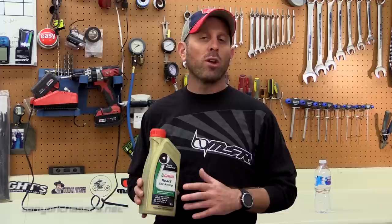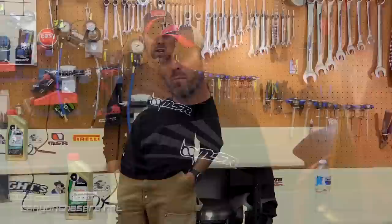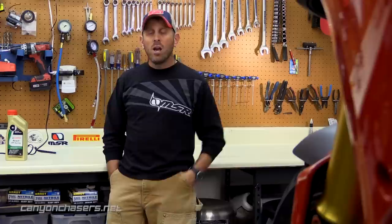We flushed the front and rear brakes on several Multistratas and still had a little left over. Here's the thing: the dry boiling point on the Castrol SRF is lower than the racing fluid by a few degrees at 590, but its wet boiling point is more than 100 degrees better — 520 degrees. We wanted to be sure before recommending anyone spend $70 on brake fluid, and it absolutely works. We put the React SRF into four different Multistratas ranging from a 2012 to a 2016. The brake feel still degrades over time, but on this particular bike the rear brake has gone completely untouched for two riding seasons — two years — and the rear brake still feels fine. It's good enough that I can lock the rear brake on a whim. Using traditional brake fluid, we'd notice degraded brake performance in about 500 miles, rendering the lever pretty much useless after about a thousand.